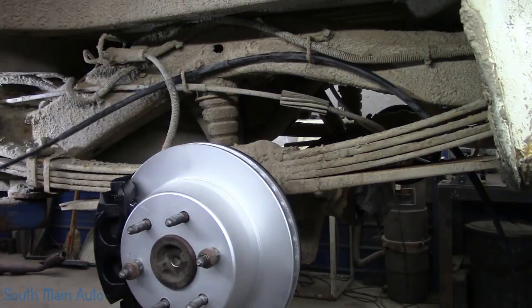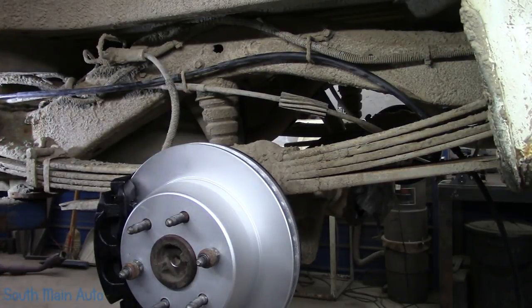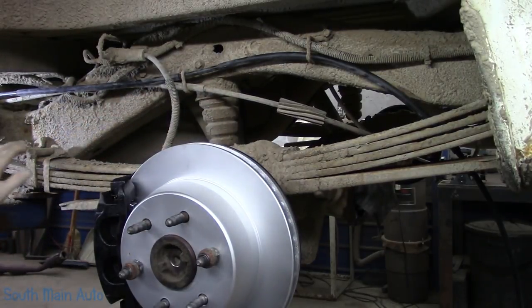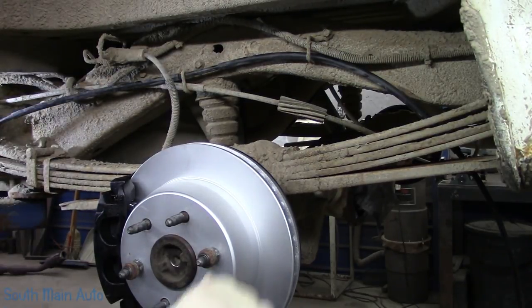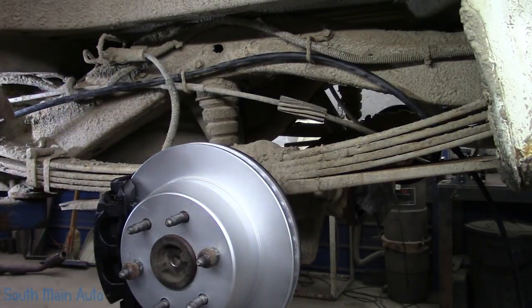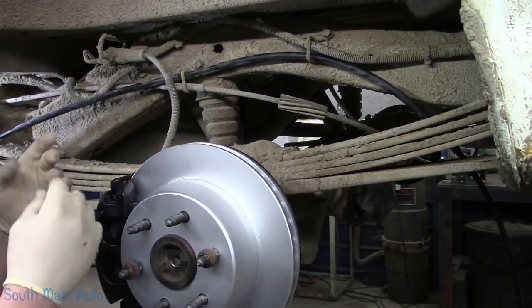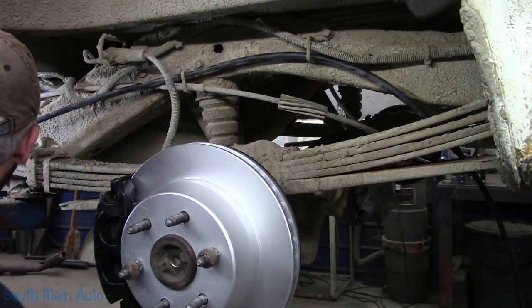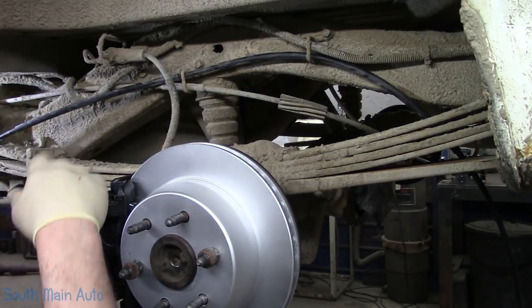Alright, that's gonna come right up here when we're done — hook that one up, so leave that one there. Now this one that runs to the passenger side, it does come through — we can't really see it, but right up in this area it goes through the frame. The plastic end on it used to click into a hole on the frame. We'll just use our pry bar, we'll smash off the end of it so we're not trying to depress the tabs. We'll likely just use the cutoff wheel, cut the cable so we don't have to fiddle with that, and then fish that one out.